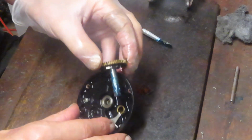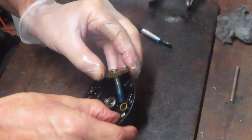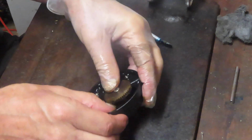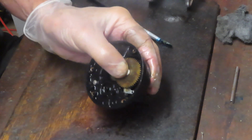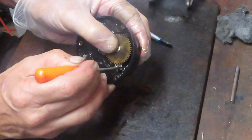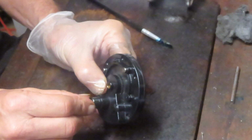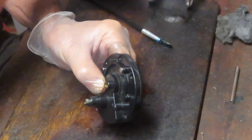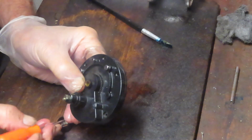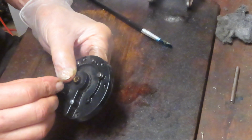All right, I mentioned you're going to take that dog and just hold it down and pull it back and get it started so that it clears the gear shaft. Bring it down, and then the final piece is to take your pick or something and pull that dog away so that you can tighten that down the rest of the way. I'm going to come to the outside of this. I did see that we have the washer and the cap, so no better time than maybe trying to put it on right now.